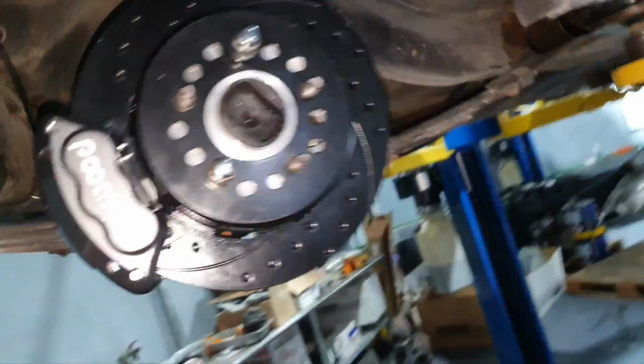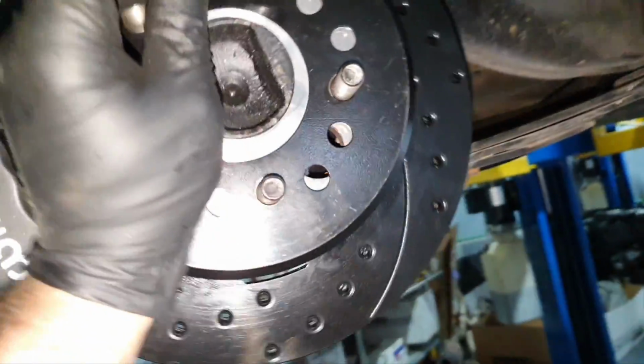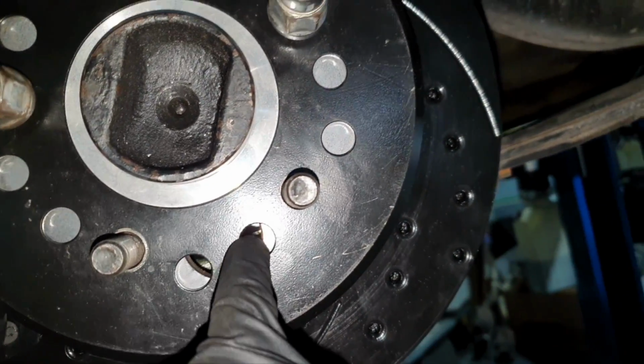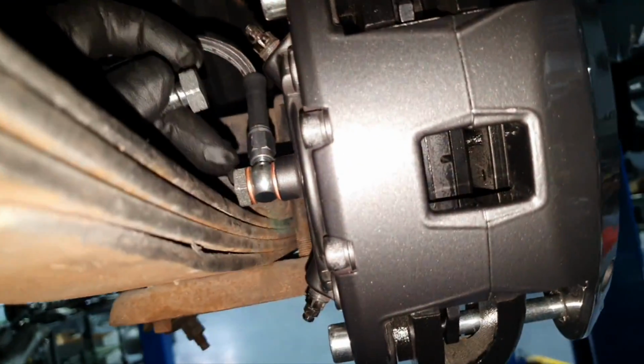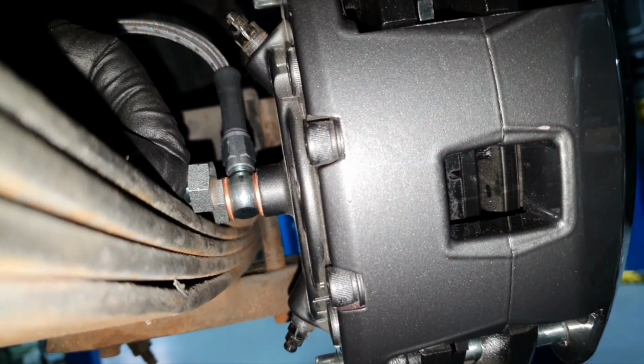Rear right, it's done from the brakes. One adjustment here inside on the handbrake at the end, on that screw there inside. Then, what I want to say, I machined this bolt here because it's much thicker and it's not giving me clearance.